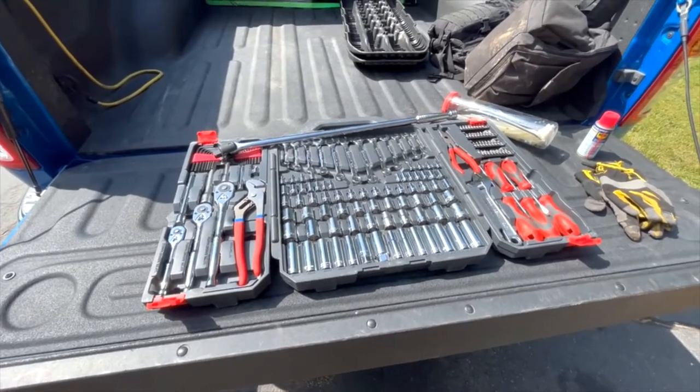Let's go through what I found underneath the truck and under the hood. Everything was metric, so when you're thinking about your toolkit, you can bring standard but you may not need it. Running from small to large: nothing was 8mm, nothing was 9mm. 10 millimeters covers the front diff cover bolts — in case you need to tighten a bolt on the trail — and the ignition coils, if you have a bad coil or need to check a plug.